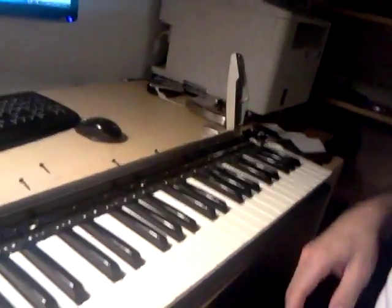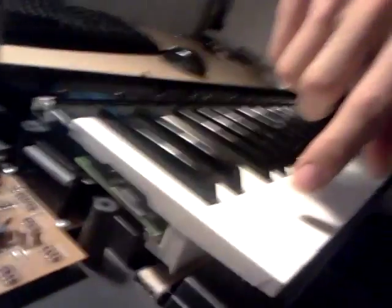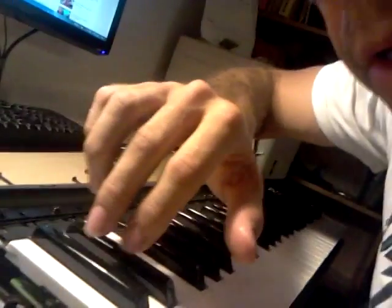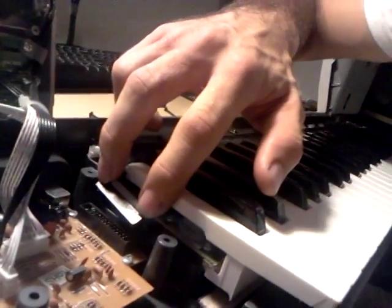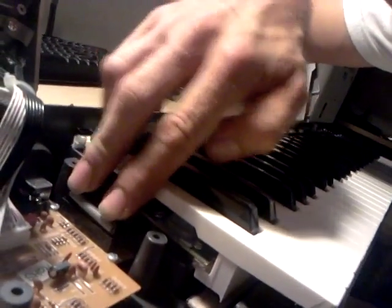So I'm going to show you what I did. As you can see here I took the cover off, and much to my surprise this little connector up here was disconnected. It doesn't have a click but it was simply off. I just put it back, clicked it in, and then went back to MIDI AUX and all the keys are working.